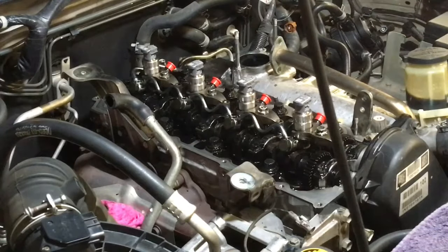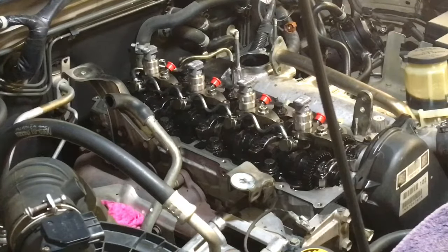We need some tools, okay. I'll take my deep reach 12mm off the impact driver. What's the torque setting for the injectors, guys? You should know. If you're watching the video, you should have looked it up first, so then you pass the test. So if you haven't, hit pause, go and have a look at them all and see if you can remember. We're going to go 22.